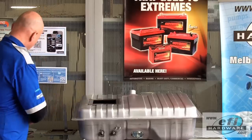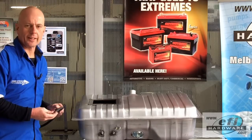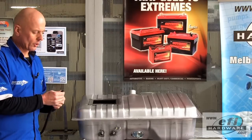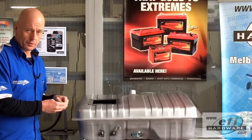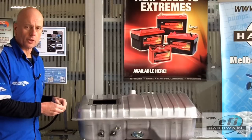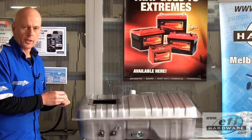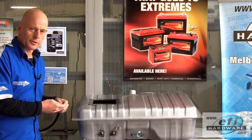First, we'll talk about the choice of hose. There is a difference between regular EFI hose and in-tank hose. Normal EFI hose has a different outer braid to the inner braid, and if you use the regular exterior type hose it swells up like a sponge — the clamps lose their clamping ability and the hose inevitably falls off the fittings inside.